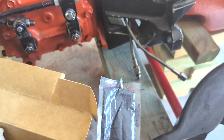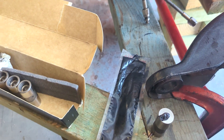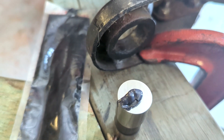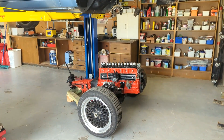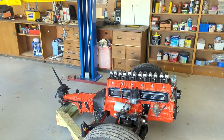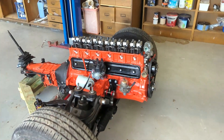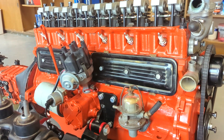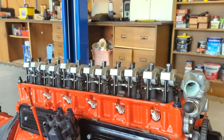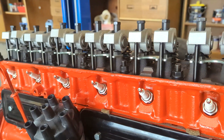I'm modifying all of these studs so they screw down to the right depth and bear well on those plates, giving me clearance on everything when I put the roller rocker on. I'm whacking in these solid lifters — this is the graphite-type goop, it came with the CamTech cam and these are CamTech lifters. I'm putting a bit of that goop on the face and spreading it out, then slipping them into the holes. I've done a bit of work and got all the lifters in with all my push rods and roller rockers on.